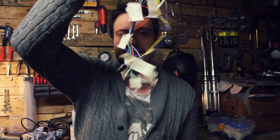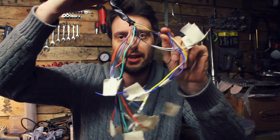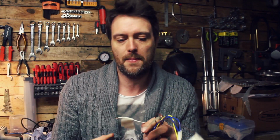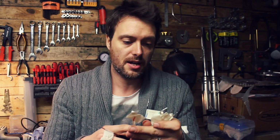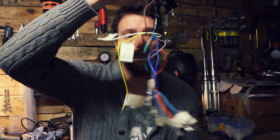And guys, so there you have it. We have a complete controls unit with all these little dangly wires and everything labelled. So we have everything from dip to side lights to the input lights, indicators, right dial, left dial, all sorts, input indicators. We have absolutely everything here. And that is how to identify a load of wires that you don't really know where they come from. Of course, identifying the wires on the actual bike itself is a lot easier than that.